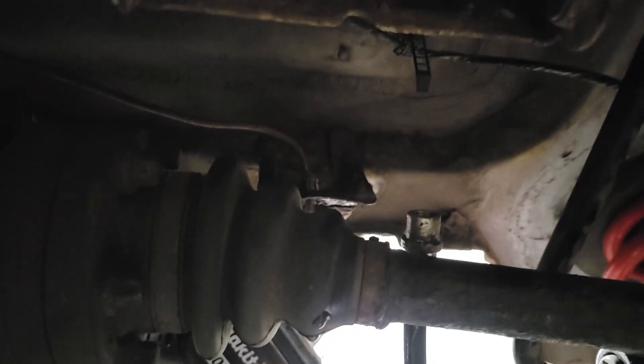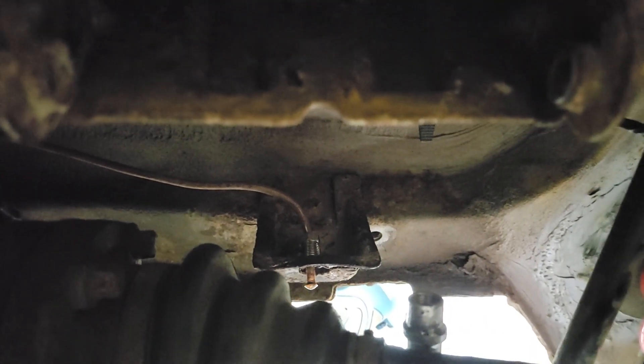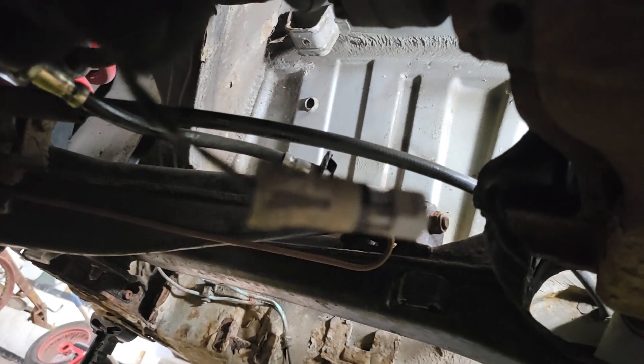You can see brake fluid dripping there because I've disconnected the flexi lines that go down to the subframe. I've done it up top here rather than where it's a bit more accessible — it might be easier down here because I want to be able to clean up some of these mounts before everything goes back on, give them a coat of paint and actually a bit of welding as well. They were so stuck on when I took them off last time — two years ago probably — that they got a bit mangled, so I might just weld them up before I give them a coat of paint. Both flexi lines are off now and dripping. It's a good opportunity to change the brake fluid and put some fresh stuff in. The cable that connects into the diff is disconnected, and the brake sensors and speed sensor on the rear wheel are disconnected as well.